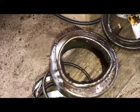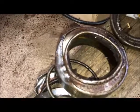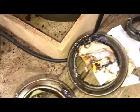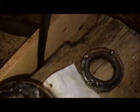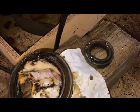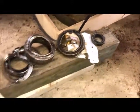So this is the one I was telling you about. It's the one behind the brake drum there. You get the front part of it out, which is here to the left, by drilling and pulling, and then you got to get a gear puller back behind this one in the space it makes in order to get this to pull out. And there was the other brake shaft oil seal that I pulled out. You noticed I had to use 3 holes to get it to come out, but that's probably all the good news I can give you today.